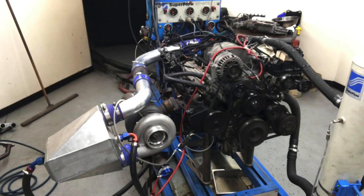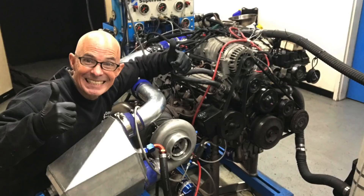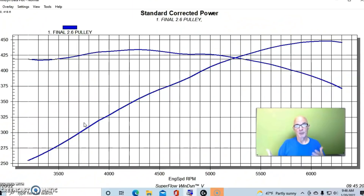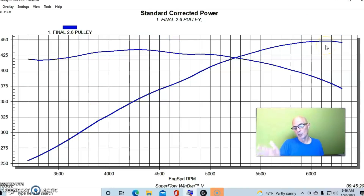Let's look at why I turned the boost up even further on the turbo. After running all the testing comparing the 2.6 inch blower pulley combination with the turbo, I wanted to reach a certain power level — even though I hadn't checked the ring gap, I didn't have head studs or MLS gaskets, and I hadn't really prepped it for big power. I wanted to exceed all the supercharged combinations I'd run previously, including a compound system — which wasn't a modified version but a stock setup.